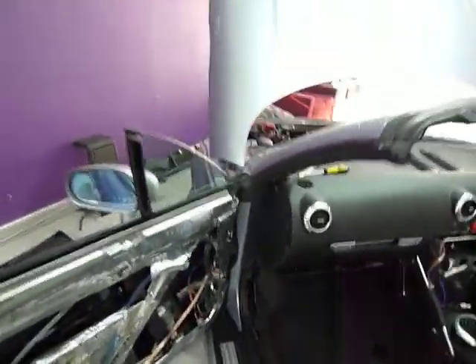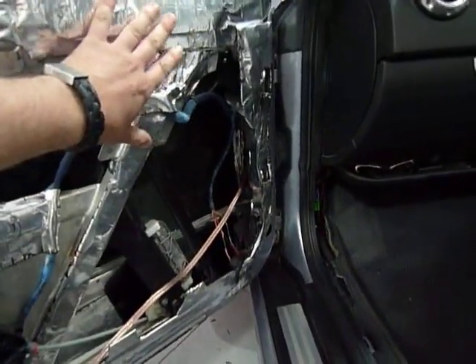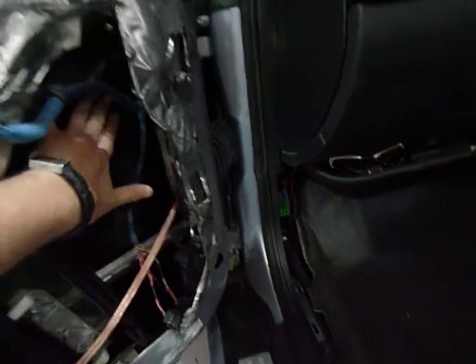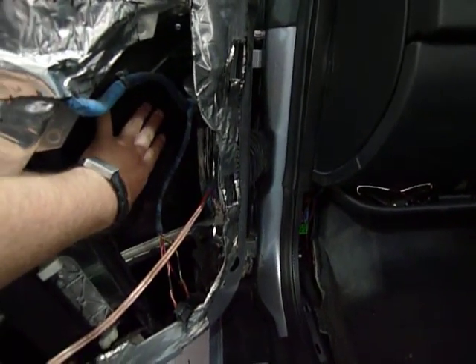What we've got here in the doors is that Julian, the owner, has applied our rules on soundproofing. He's soundproofed the inner side of the door, he's done the inner skin of the door, and also in here he's put high-frequency foam as well to deflect the airwaves on the high-frequency speakers.